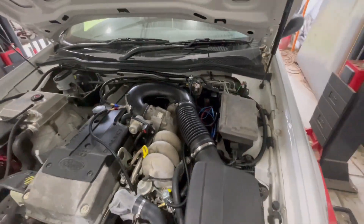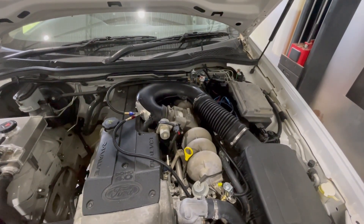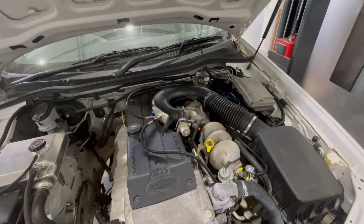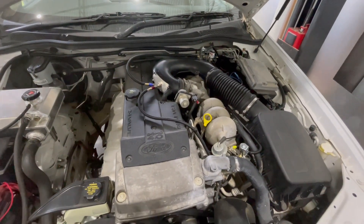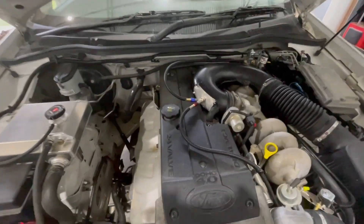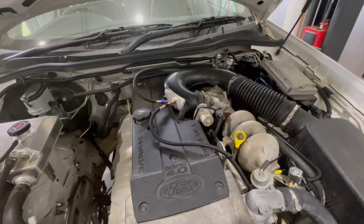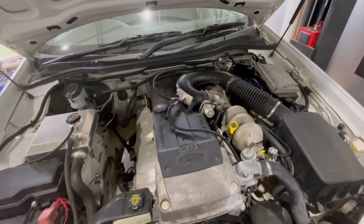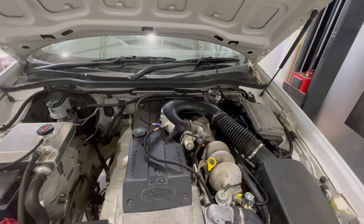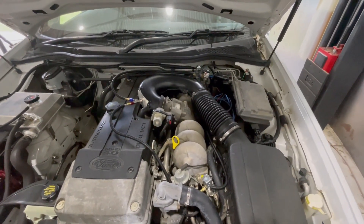Hopefully I'll be able to post results in another video — I'm going drag racing again in about a month at Gunnedah Airport. That's only an eighth mile, but comparing those times to my Sydney times should give a rough idea of how much the nitrous kit has pushed the car. I'm contemplating changing the 75-horsepower jets for 100s. Testing on my secret test track, it's very noticeable when you press that button — more than any exhaust system or cold air intake will ever do. Money well spent. Keep modifying those barrels — that's it for this episode.